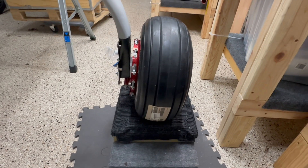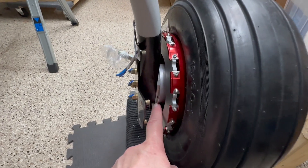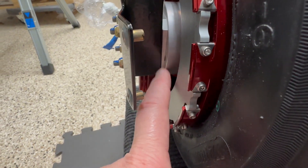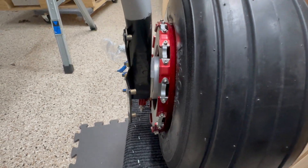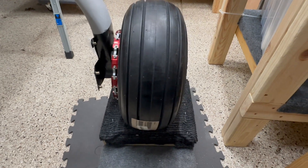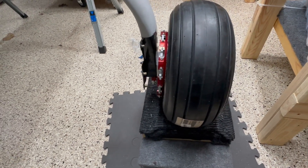I'm still a little concerned about some of the angle, but the shim looks correct. You can see the shim sitting in there — thick side to the top, thin side to the bottom. The gap in the leg itself looks pretty good. I'm comfortable with it. I just have a positive camber to the wheel, which I presume is normal, but that still has to get done.